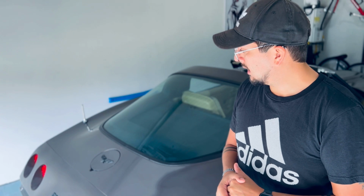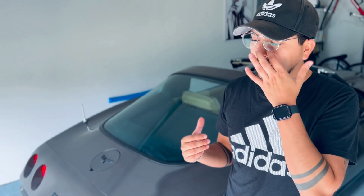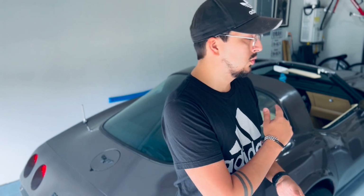With that being said, I am going to start from the easiest part. I checked the fuses and they're all working. The other gauges are working aside from the clock, as you guys may know. But I'm gonna start from the back. I'm gonna check to see if the wiring to the actual tank is working properly, and if it's not, then that should be the problem. My next step would be to go into the gauges and start tearing it up.